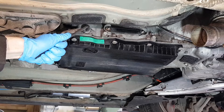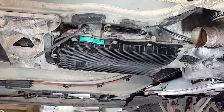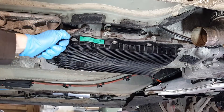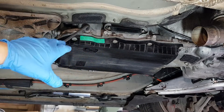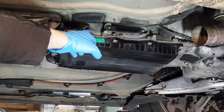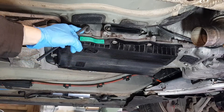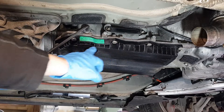It is a bit difficult if this has never been done before, so you may want to get a little extension — that's what I did off camera. I have loosened it; this is an 8 millimetre hex. Just loosen it so you know you can fill your gearbox, because you don't want to drain the oil and then not be able to open the filler, strip it or something silly like that. Make sure you can open it first, then we're going to drain the oil and remove the sump.